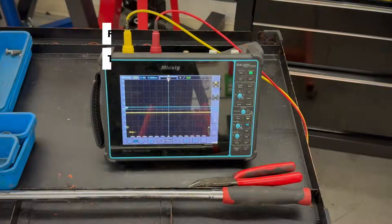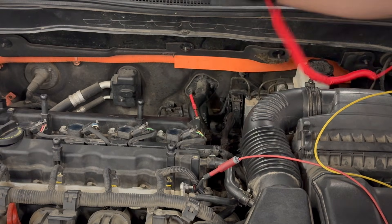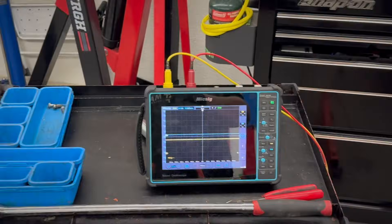What I'm going to do next is run that same test but now right at the actual sensor. So I'm going to back-probe the sensor signal there. Notice how, when I'm doing it here at the sensor, I'm getting zero response from that actual sensor — and I'm going to point you guys over to my lab scope and you'll also see we have no response. To me, this seems like I have a circuit problem. More than likely, it looks like either a grounded signal wire or an open signal wire, because when I'm at the PCM and I ground it, I can simulate the signal. But if I'm at the sensor and I ground it, it's not simulating whatsoever. What I'm going to do right now is overlay a wire from the sensor over to the PCM, start the engine, and look at the lab scope to see if that waveform comes back.